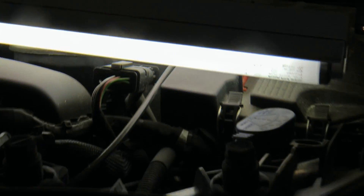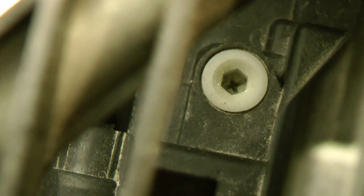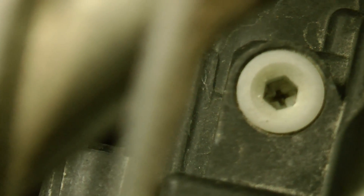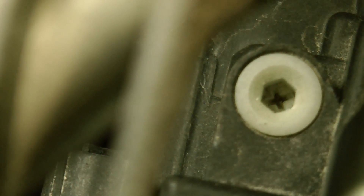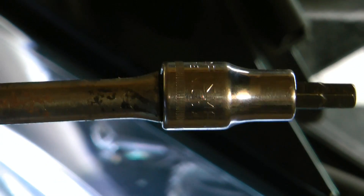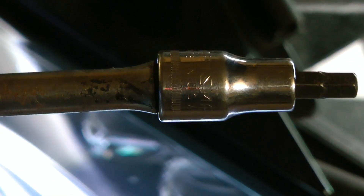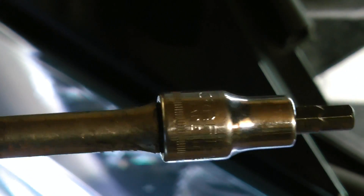Apparently the way to adjust these lights is to turn this screw — you can see it's a hex head. It does have a Phillips head in there but my standard number two Phillips won't fit, and my number one Phillips is not long enough to get down there. You can do it with the number two sort of, but I'm going to use a 6mm hex mounted on an extension, stick it into that hole, and turn it — apparently two turns is what it takes.